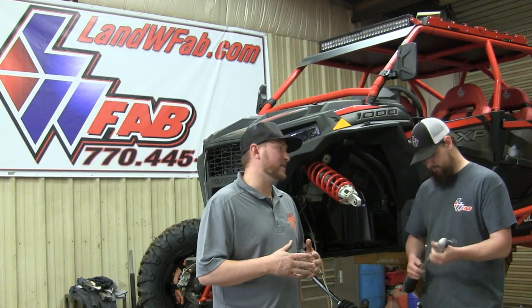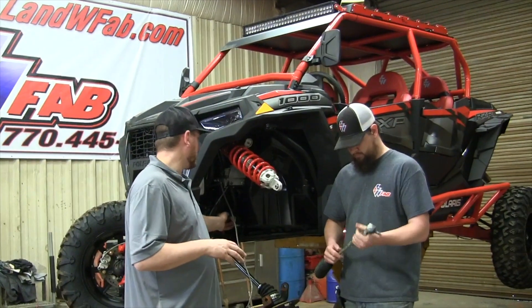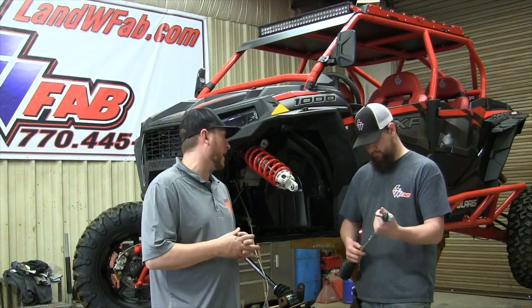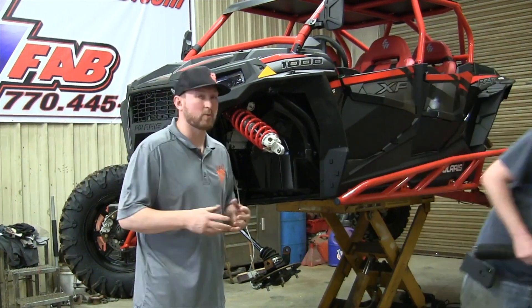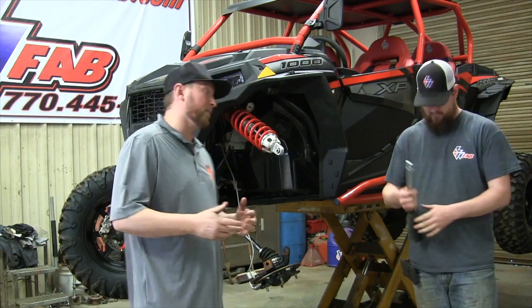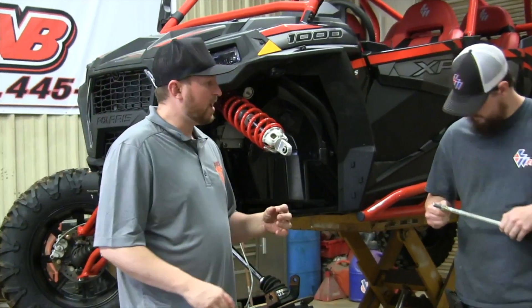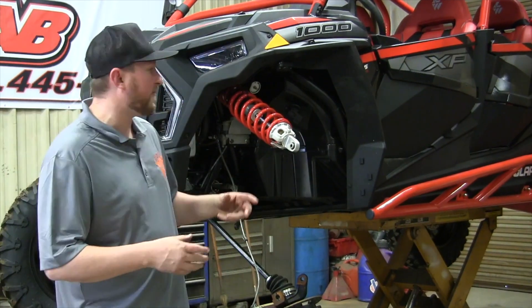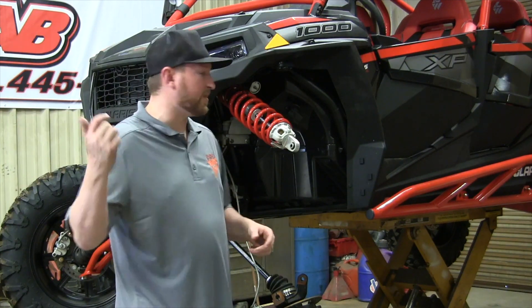If you rip your boot from the inside there's really no way to keep it able to hold in the grease on the actual steering rack itself, and you risk harm to your steering rack. The boots are not cheap and they're not always readily available at your local parts store — you'll have to order OEM. He's removed the front side of the shaft; with these models they come apart in half. He'll remove the nut from the center and then he'll be able to slide the boot right off.